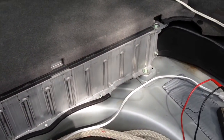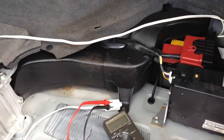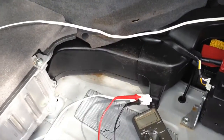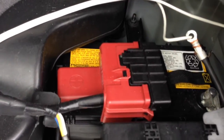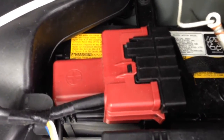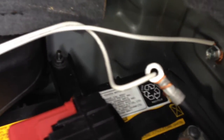In addition to that battery, there is another battery — the regular battery, like any other car. It's called the auxiliary battery in the Prius, and it is located to the right as you look at the trunk from the back, under this cover here. If you remove this cover, underneath is the auxiliary battery. This is a 12-volt battery used to power everything else in the car. It has two poles: a positive, shown here in red, covered but right underneath here, and a negative pole attached to the body of the car with this wire.